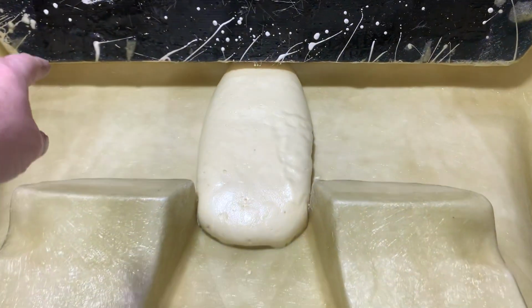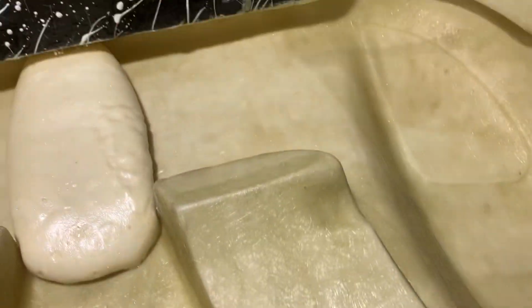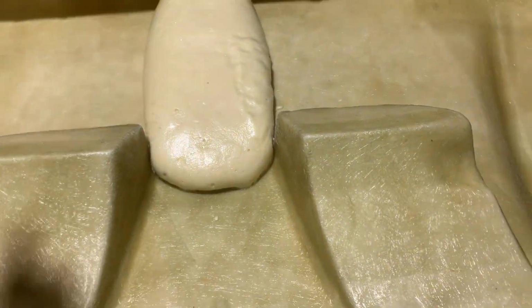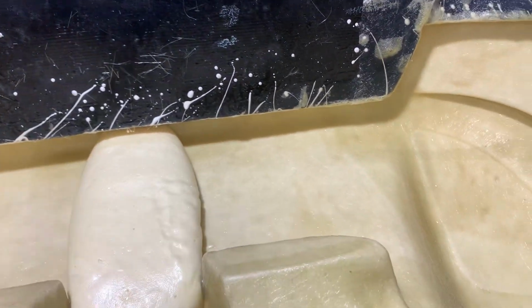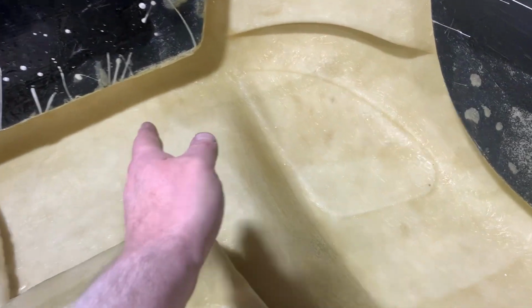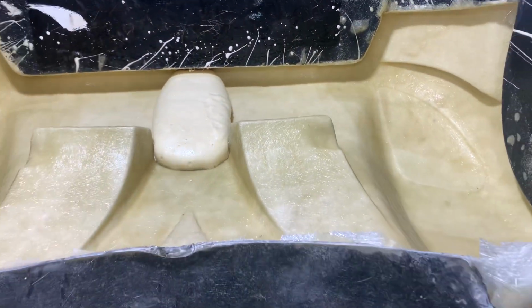You know, we could add a secondary piece of insert fiberglass to this point here to add some actual structure, but then that always tends to get in the way of any airflow from radiators and from other stuff. It just gets in the bloody way, so it's a pain in the ass. And we no longer need to use those secondary parts as the pivoting point, because we're going to put flanges, or gussets should be saying, into the front there, which is where the pivot point for the front clip is.